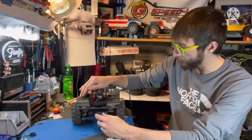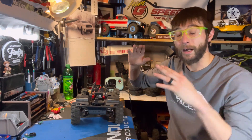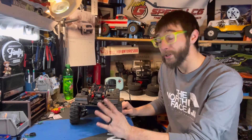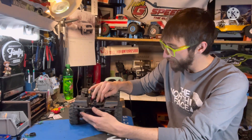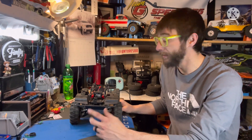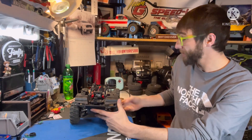I'm super happy with the way everything came out. There are also some modifications mentioned for the upper arm — a little bit of trimming to make sure the bracket on top of the knuckle sets flush. With the pivot balls now underneath, that angle plays a bit more of an effect. If it has too much bump steer for you, you can shave that down so the mount sets flush. Overall I'm happy with it — mostly I'm gaining clearance, and I'm not running this truck at excessive speeds or jumping it, so the bump steer doesn't bother me.